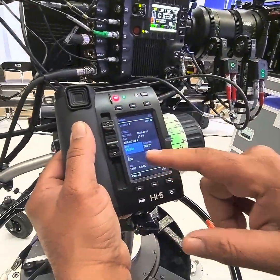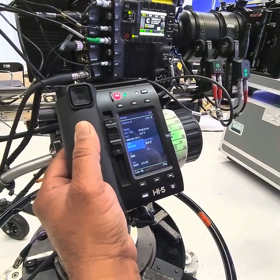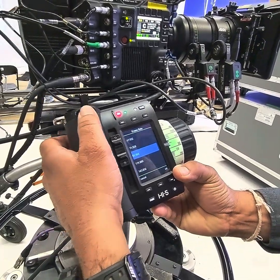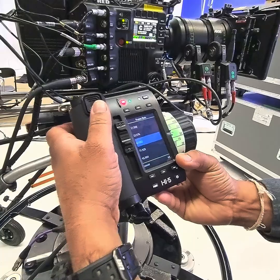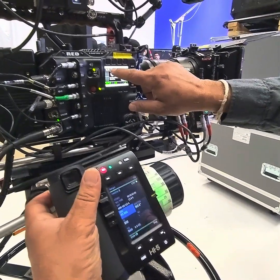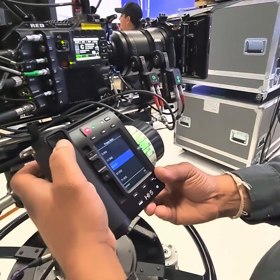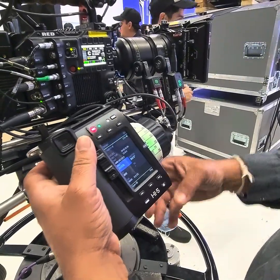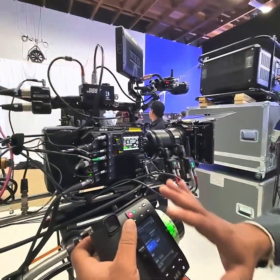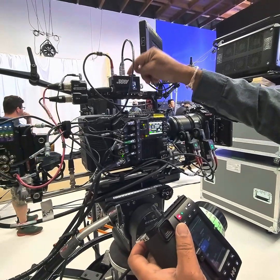So now I can actually control the frame rate, the EI, the white balance, and the shutter right from the handset of the High Five. For example, if I want to change the frame rate, I could change it to 23.976. Right now this says 95.9 — and that's 23.98. All I did was click the button here. I'm going to change it back so I don't forget, to 95.9. So that's really nice. I have some control of the camera from my High Five handset just with one cable going into the cam port of the rear.